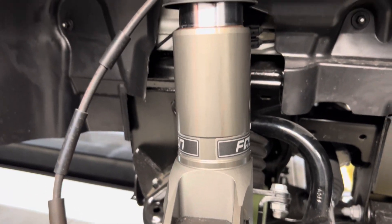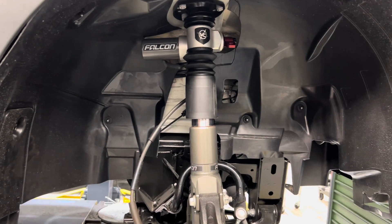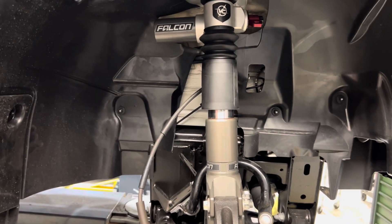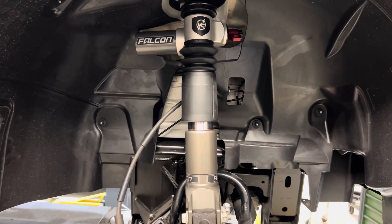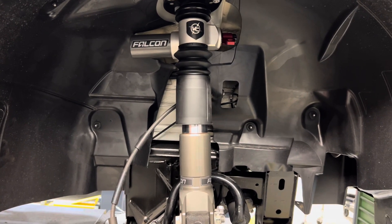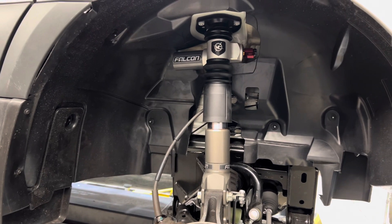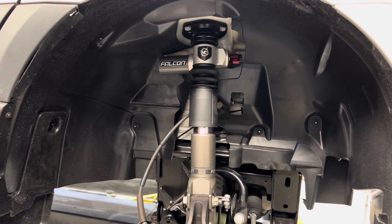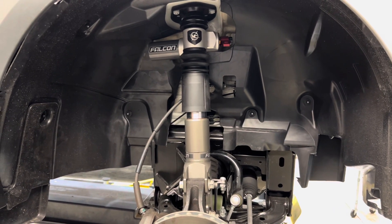These are the adjustable units for four-wheel drive. There are also non-adjustable units called mono tube rally struts — no adjuster — for four-wheel drive, and the same types of orientation for rear-wheel drive. So there's a 10-way adjustable front strut and a mono tube non-adjustable front strut for rear-wheel drives — four total struts depending on whether you have rear-wheel drive or four-wheel drive slash all-wheel drive, and whether you want adjustable or not.